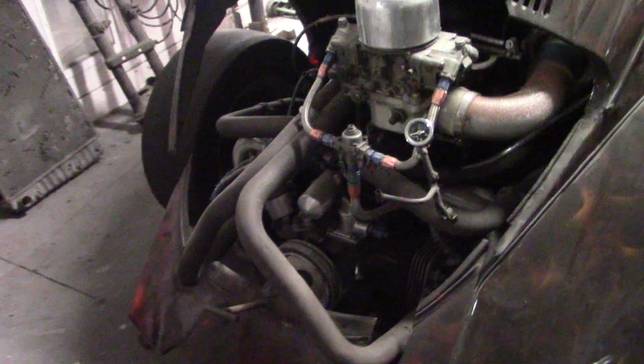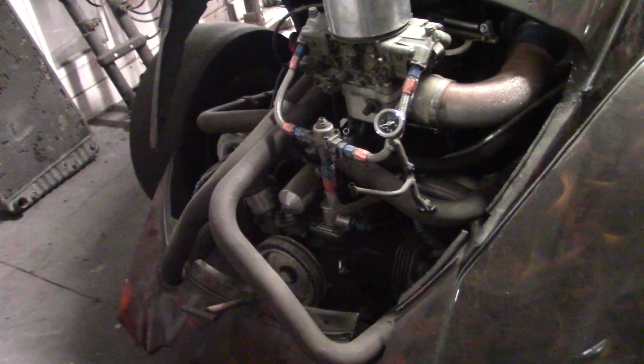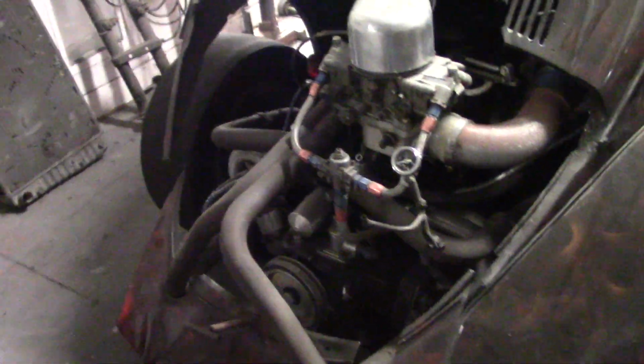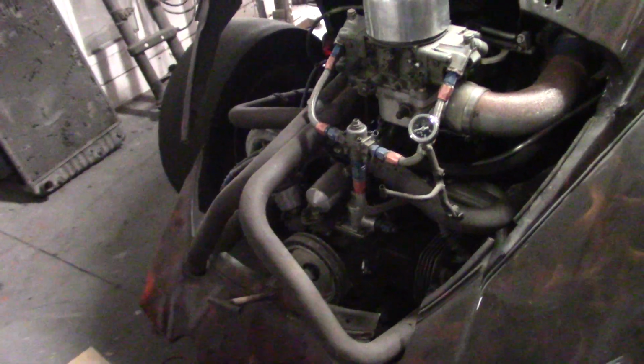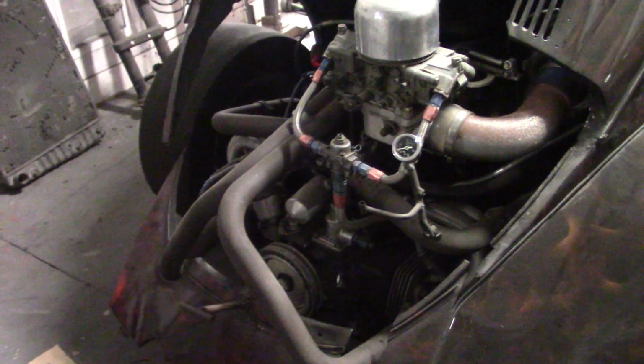That's pretty much a Scat motor in the drag car over here in the maze of parts. And we're going to be taking this apart soon. I'm going to pull this out and service the motor, so we'll get a look at this. This is a Volstroker chrome moly. I think they call this the billet 4130 race crank. I've had this since, I guess, about 1985, so the crank's pretty old. The rods are a set of bug pack rods that Gene Berg put bolts in for me and resized. And the bolts cost more than probably two sets of the rods. I think the rods are $250 and the bolts are $400.